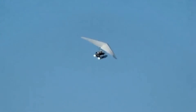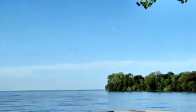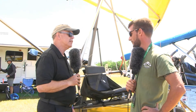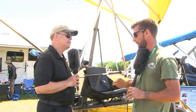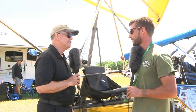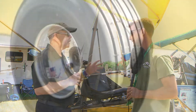People will look at an aircraft like this and say, wait — he said it was Part 103 but it's got retractable gear, it's got floats, and I think it had electric start. Some people think that means it can't be Part 103, but they're wrong, aren't they? They are wrong. We have an additional float allowance of 60 pounds, which gives us the ability to — since we integrate the frame into the floats — make an amphibious trike. The basic Part 103 is a 254-pound empty weight.